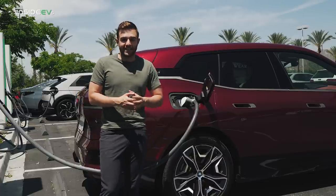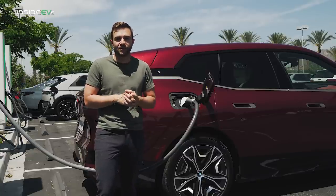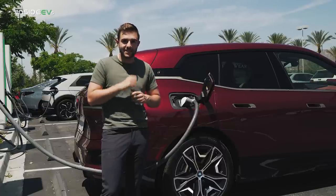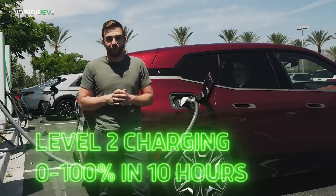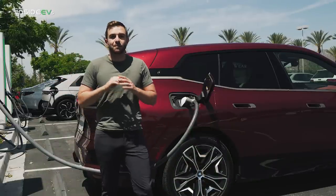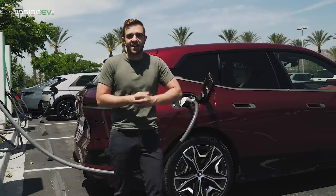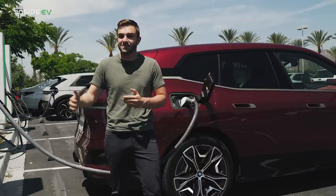The iX has a big battery pack, at least in this spec — the iX50. This car has a 111-kilowatt-hour pack, or 105 kilowatt-hours net usable capacity. BMW will also sell you an iX40 trim with a smaller battery, and there's going to be an iX60, maybe even an iXM at some point. At Level 2, the BMW iX will charge in 10 hours and 20 minutes — definitely an overnight job. Here at the Electrify America station, it'll do a peak charge rate of 195 kilowatts, translating to 10–80% state of charge in just under 40 minutes — high 30-minute range, just enough time to go grab lunch and come back to a charged car. 195 kilowatts is good, but in today's modern landscape of EVs getting faster and faster, it's definitely not the best.